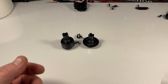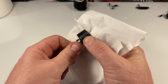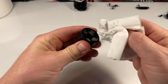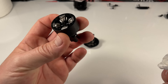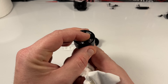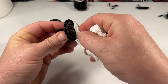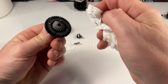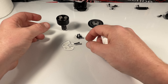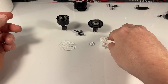About 15 minutes went by — much better. A little wipe here and this is about it. You still have some of the stock fluid in there, but you're fine. Instead of a million you might end up with like 900,000 if there's still some residue — no biggie at all. Most of the diff fluid is completely removed. You can take the diff and clean it really well to make sure nothing is left, but it's fine. Obviously when you're locking diffs you have to go through that hassle, but on this one, not really.